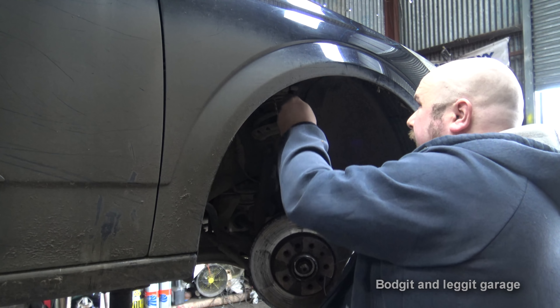Job done. Do the other side, then I'm going to do the back. Just in case you thought the other side wasn't too bad — look at this: no pad here, this is metal on metal, it's worn through the actual disc. That's just metal on metal. So that's why we're changing them. And just in case you thought the rear back one was okay — same thing, just rubbing metal on metal, really rusty, really bad. Now, I know once I start showing this side people are going to say this looks practically new — there's still meat left on the pads, why are you changing it?